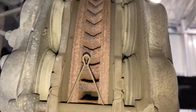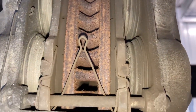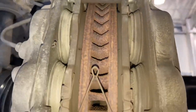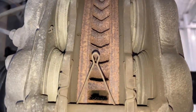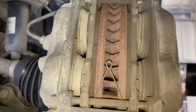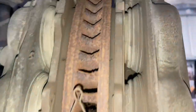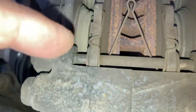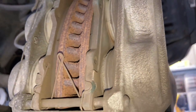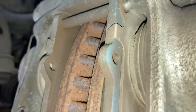If I'm going to muck around here I'm just going to change the pads on this one. If it were my vehicle I'd be changing the pads and working the pistons as part of the process - making sure everything's right. So it's: disassemble, check, replace pads, put it back together. If we find a tight piston we'd be looking for why - is there a hole in a boot? We check all the boots carefully. Someone may have changed pads before - these could be aftermarket Bendix, which often only last 30,000 k's. But no, they're blue - I reckon they're the original pads.